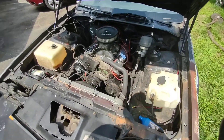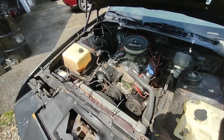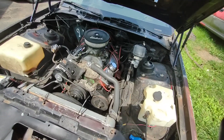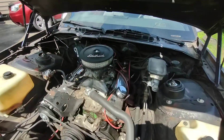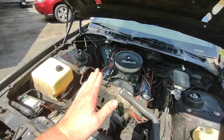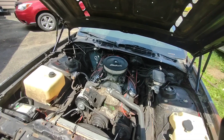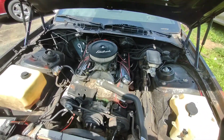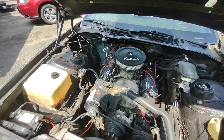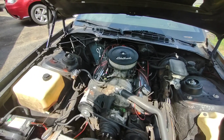That's really the two main things I've changed on this engine. Other than that, I've driven it probably about 1,500 miles right now, so I still got some tinkering to do on the carb. I think I got to make the secondary jets a little bit bigger because when I get on it, it seems like fuel starts kind of cutting out in the higher RPMs — like it's just not getting enough.